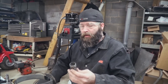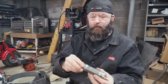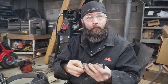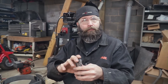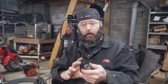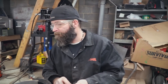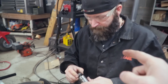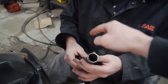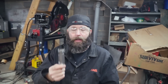Good news — I've got the head tube welded together and these bearings fit in there very snug; you have to hammer them in and out. The only thing I have left is I want to put a collar right in the center of the two bearings so when we tighten things up it won't put unwanted load on the bearings and cause premature failure. This is a little bit rigged up but we don't have a full machine shop or a lathe. The shoulder keeps the bearing from going down in the hole too far. Let's get that installed and start working on our frame.